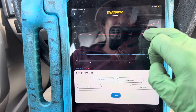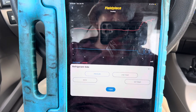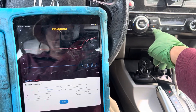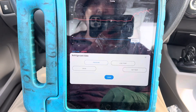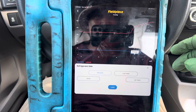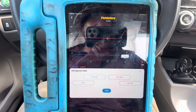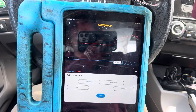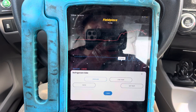You can see the compressor is cycling. Let's watch the high-side pressure — remember it's a cool day, about 64 degrees outside, but recycled air from the engine compartment is bringing it up to 72 degrees in front of the evaporator. We're on recycle mode now so there's less heat load over the evaporator. By now the thermostat has opened up fully, the radiator is really hot, and hot air from the engine compartment is pulling over and under the condenser, reheating it since we're in a stagnant stationary test — not driving down the road.